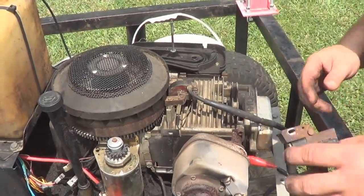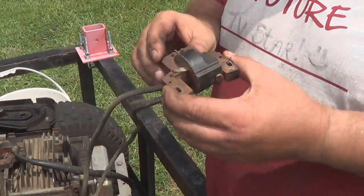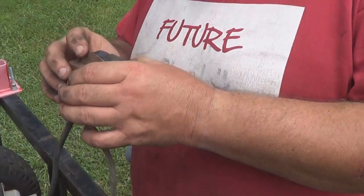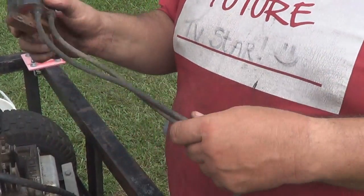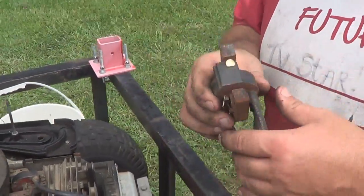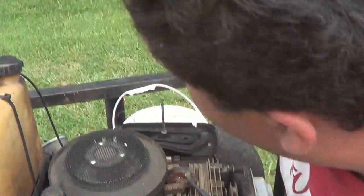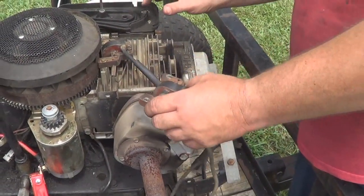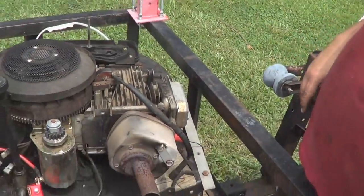On some line mowers, even twin cylinders like this one, it's got two spark plugs — that cuts off your magneto. There's still a kill wire on it. This is for a single piston; this is for a dual cylinder, or two pistons. My riding mower up there is a V-twin — it's got two separate coils, one for each cylinder. They've got a kill wire that grounds it out, but it's got a diode hooked in series with it. If that diode shorts out, it'll kill the motor — it won't let it start until you replace the diode.